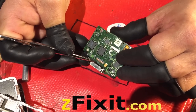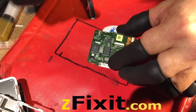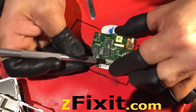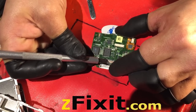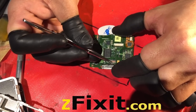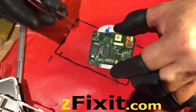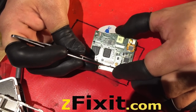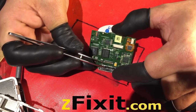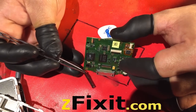Here's the plastic covering behind the charge port — it kind of protects the many pins there and prevents anything from touching them. You want to first remove the spacer that goes between the hard drive flex, which raises it into proper position. It's just secured with adhesive — just lift up and remove it. Sometimes that spacer sits over the piece of plastic covering the charge port. Now remove the plastic protective coating that goes over the charge port. You can use Kapton tape if you cannot reuse this — especially with water/moisture exposure, as it will have particles of rust and corrosion on it.